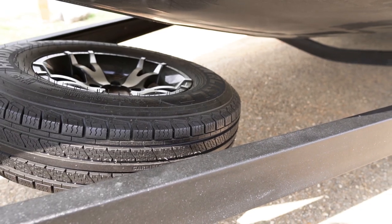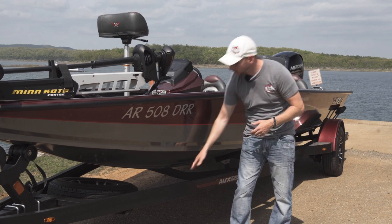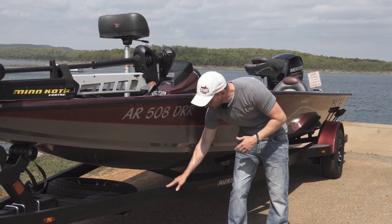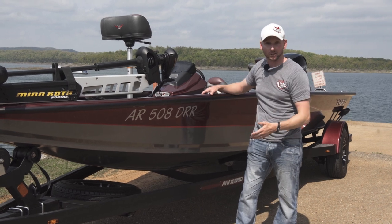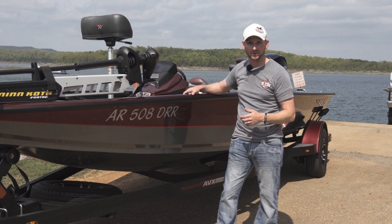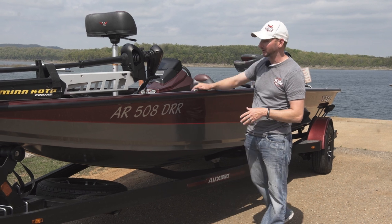You've got a four-inch C-channel trailer, so you're not going to have the internal problems like a tubular trailer rusting internally. You've got the wiring that runs into a pipe here on the side. You have what's called the Victor Shield protectant that's on the trailer. This is going to protect it from the pitting of rock chips from your truck throwing it up going down a gravel road or just going down the highway — definitely enhances the trailer in terms of functionality and preventing it from rusting.